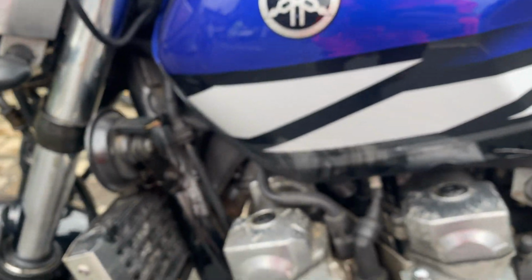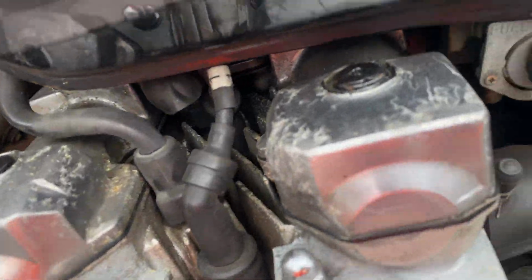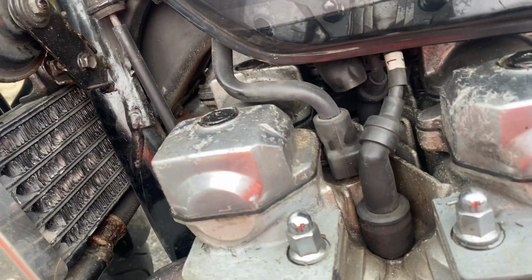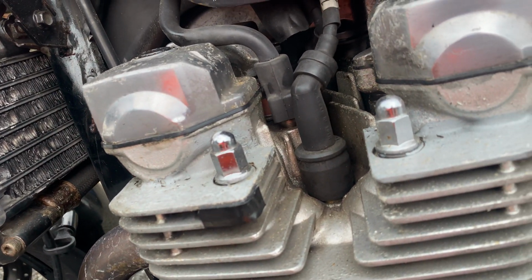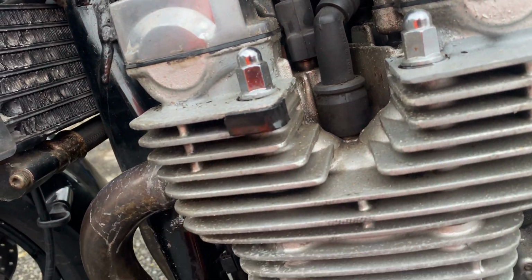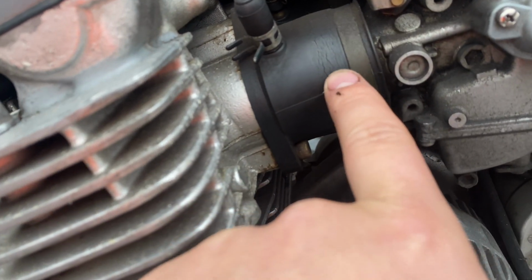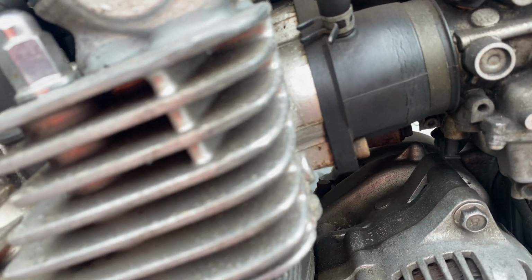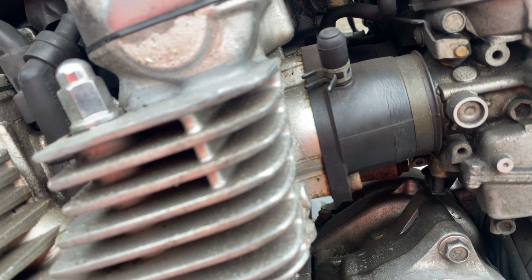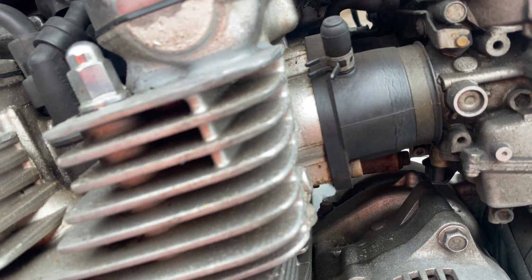Show the engine. So lots of bit of corrosion on the aluminium. As you can see, there's no oil leaks, which is quite common with these. You normally do get oil leaks on them, but this one hasn't. Got a slight cracking on the inlet rubbers, on the outlet rubbers, sorry. But they're that thick that they'll never crack all the way through.